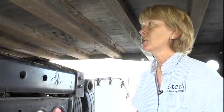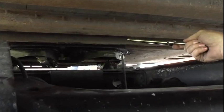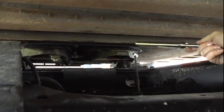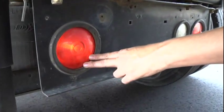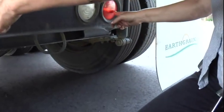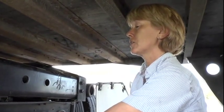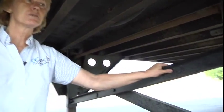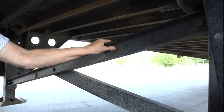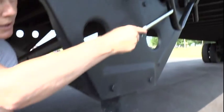Before you come out from under your tractor, look up the throat of your fifth wheel. My kingpin is properly mounted and secured. It's not cracked, broken, or missing. My locking jaws are locked around the kingpin shank. Then come to your lights — my left and right turn signal, four-way flashers, brake lights, and running lights are properly mounted and secured, not cracked, broken, or missing, and the proper color is red. My landing gear is properly mounted and secured. It's not cracked, broken, or missing any parts. It's in the upright position, and my handle is locked in place.